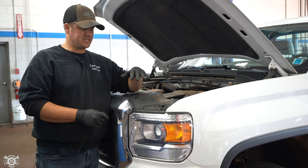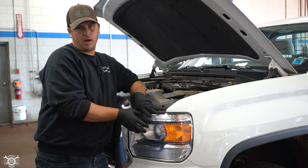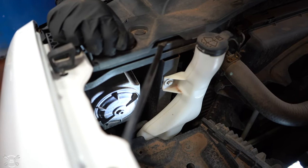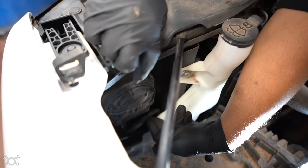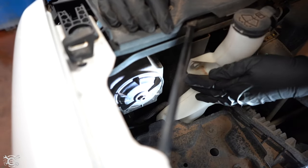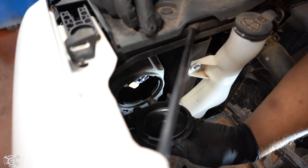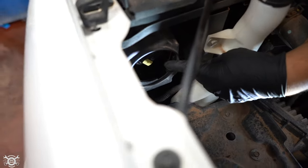I'll show you around the back of this headlight assembly. On this one, you can actually do the headlight bulb without removing the headlight assembly. This is the back of the headlight assembly — you'll notice your wiring harness running down here feeding all the power into the unit, and then you've got this cover here. You're going to want to turn this cover off; it's got a seal on the back side that keeps the weather out.